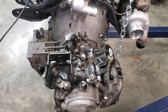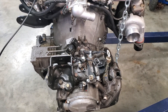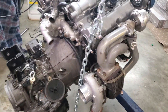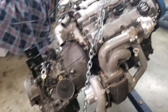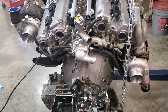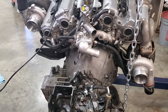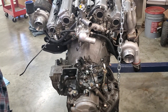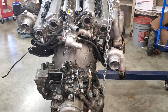We'll have to take the transmission off of course. The hardest part is getting underneath it to remove the torque converter bolts — probably should have done that while the engine was in but it was getting late. Then we can take the trans off and mount it on the engine stand by the bell housing bolt holes. We'll try to document that since there isn't a lot of info out there on doing it — it's not hard, but for people doing it the first time they question whether it's a strong enough configuration.